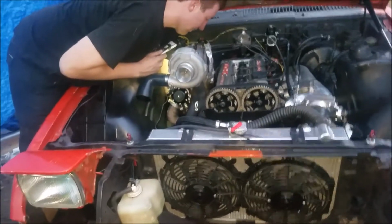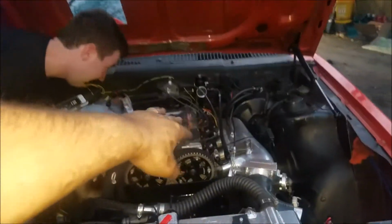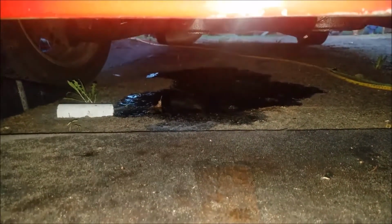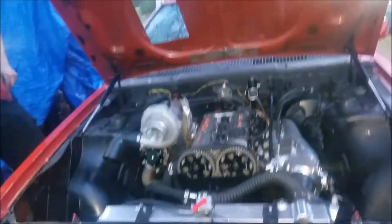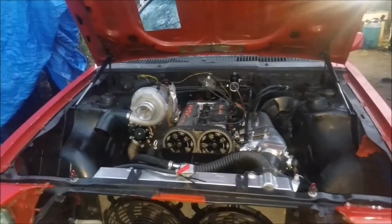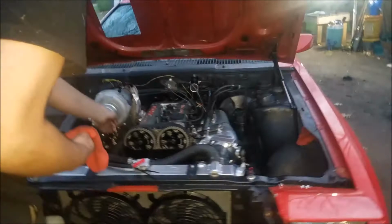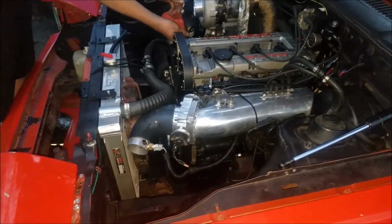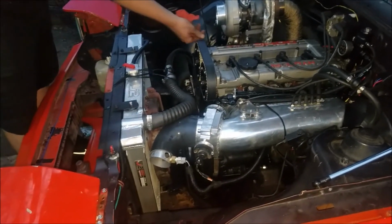Alright, so I think we figured out why the turbos were so bad in the bed. Well, we don't know. Paul's got an app on his phone, and his motor is basically level right now. If you can see, we took off the drain, and all of that oil right there, which is in a sandbox, so it's not going into the earth. It's totally eco-friendly, so nothing to worry about there. All that oil came out, and he pulled the dipstick and it seems like it's a quart low. He put 4.3 quarts in, and now that put it down to like 3.3, and that can't be right. I don't know if he needs to get a different oil pan or something. It's right at the bottom line, about a quart lower than what yours is, because that's what those notches are. So that's exciting and all, but it could be great if it could stop.